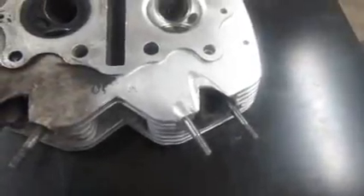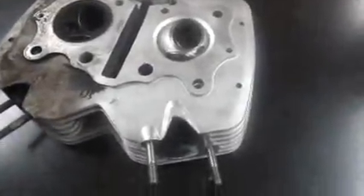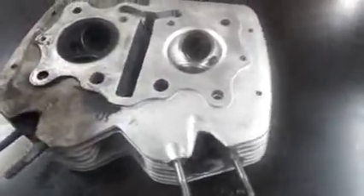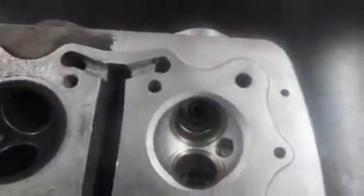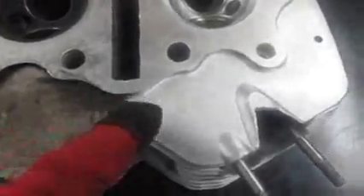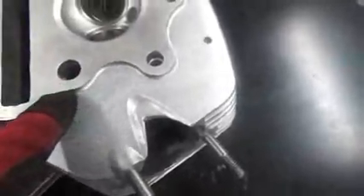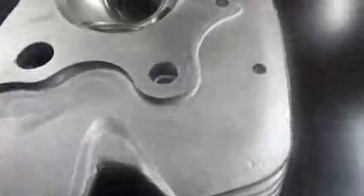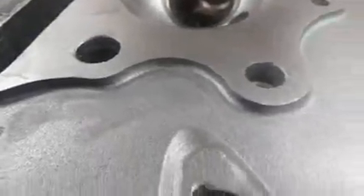You may have to scrape those areas just a little bit lightly with a flat blade screwdriver — that's what I would prefer, and that's what I always tell people to do. Same as gasket material: scrape that with a flat blade razor, and then you can vapor hone and clean those parts up. That's actually what we had to do over here in some of these areas — we had some really caked-on grime, and we just gently went in there, scraped it with a flat edge, and then you can get in there and really clean those surfaces.